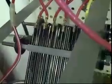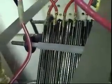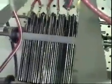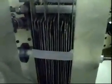Alright, so on the top of every power plate that you want to use, you have to cut out a little rectangular male piece that a female push-on connector will slide onto. It's very simple. Next time I make one, I'll show a quick video of how easy it is. You just use a Dremel tool or a rotary tool with a cutting wheel on it, and you can cut out whatever shape you want. On this diamond cell, I knew I was always going to use 5 neutral plates between each power spot, so I just have it set up like this. But normally I would have it cut out like this mini dry cell is, so that I can have 5 neutral plates between every power supply, or if I want to use 4 between each, I can just detach these and reattach where I've cut them out here to get a 4 neutral plate configuration.